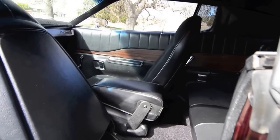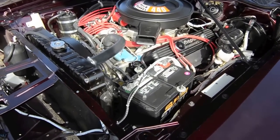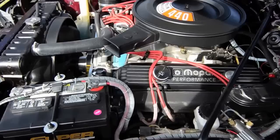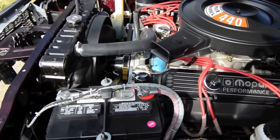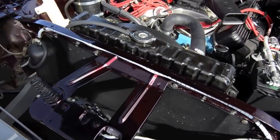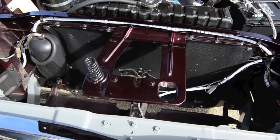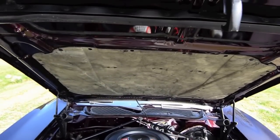Tell me about this power plant. This is a 440 — originally I believe this was a 440 car, and this is a 440 I had in my garage. It's not exactly stock anymore. It's balanced, blueprinted, decked 30 over, comp cam, SRP pistons, Holley 770, Weiand intake, MSD ignition — much more reliable. March serpentine belts and pulleys. Put in a Hurst line lock anti-roll control — just to have fun and do burnouts. Hydraulic clutch and a Truetrac differential with the Tremec TKO 500.